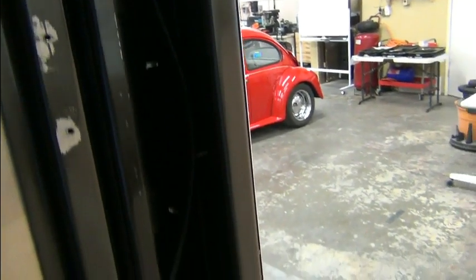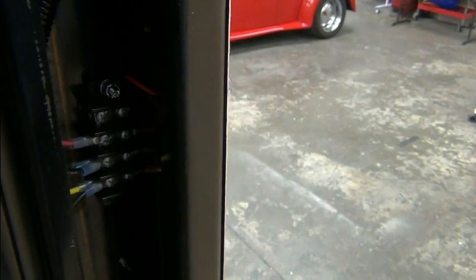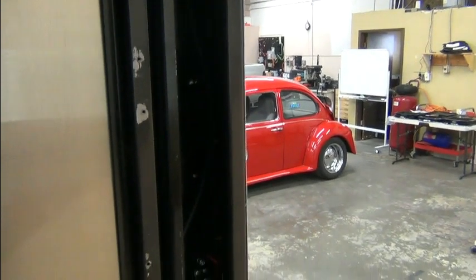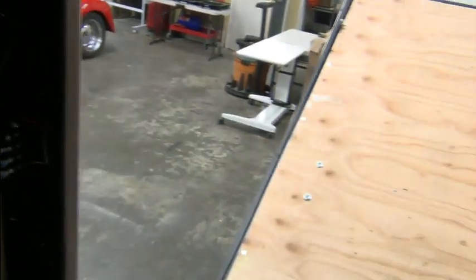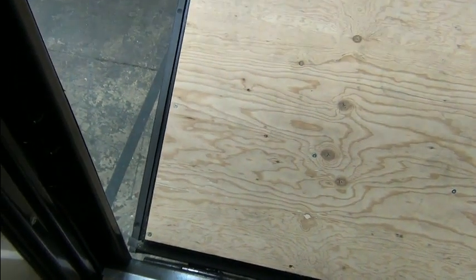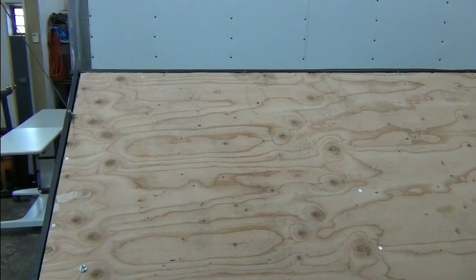I mean, it's loomed and comes down in another terminal strip and catches the tail brake and turn signals on the right side of the trailer. And they had a wire that came from the lower clearance light and went all the way up there. And so, like I said, a lot of wiring left over. And we'll use these attachment points when we add the lights to the ramp. And so they'll just drop down from here and there will be a pass through into the ramp and give us a second set of brake and turn signal lights.